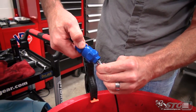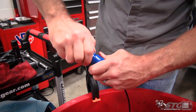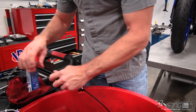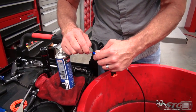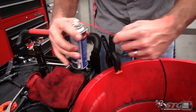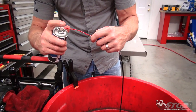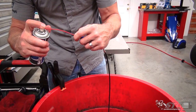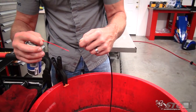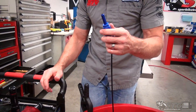Get this thing all set up here and crank down a little bit more - that's in there nice. There's really no clean way to do this, that's why I've got the trash can down here. Now I'm going to pump that in there and allow it to work all the way down the cable. I've got it all the way down now - one last little squirt. I'm going to get this all cleaned up, and when we're back I'll be mounting the cables to the R3.